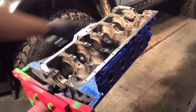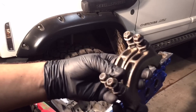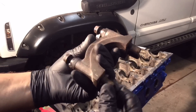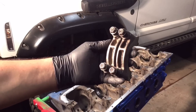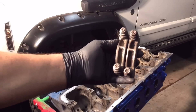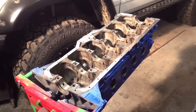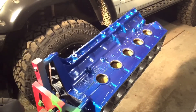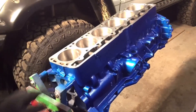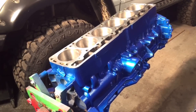The four corners are 5/16-18. Now I'm going to go ahead and clean the bolts for the main bearing caps — just hit them with the wire wheel. These caps are numbered. That's number one, that's number six, and it's critical that they go back on the journal that they came from. I'm going to finish cleaning up all the surfaces, spray it all out with brake cleaner, get it nice and clean before you move on. Got all the freeze plug holes reamed out, ready to go. Head gasket mating area is all nice and cleaned up and polished — just need to soak it down with some brake cleaner and get all the bits and pieces out before moving on.